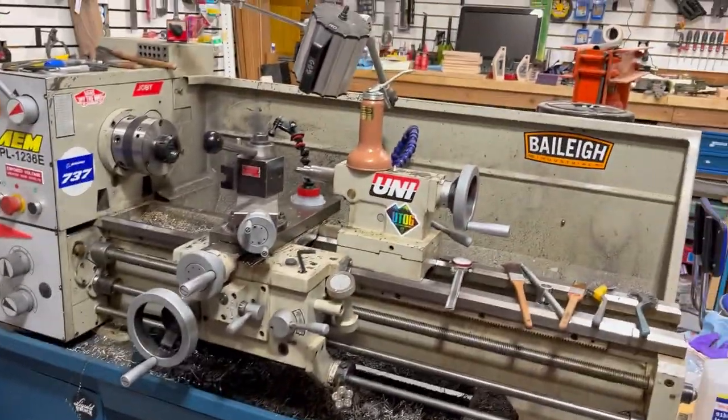So we had a hard cut here. I was in the middle of reassembling the carb and we hit a snag. Basically it's like a check valve needle that is in line in the circuit there with the acceleration pump, and it is missing in my carb. It wasn't there when I disassembled it.